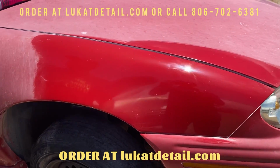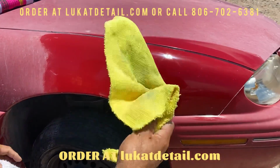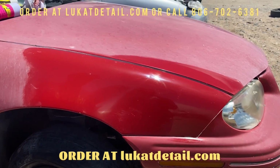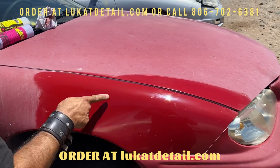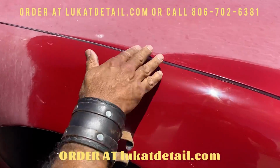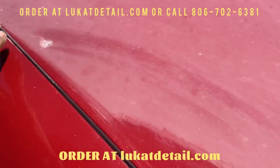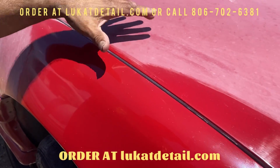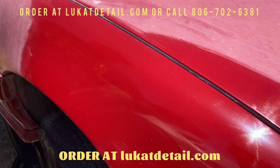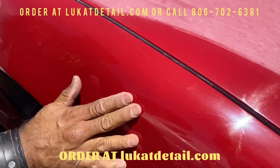Now I like using a terry cloth bath towel for the application, and I use a microfiber towel for the removal. Again, what I did here, I did not wax it. It's clean. Okay, listen to this. This paint right here, do a close-up so they can listen to this. This is dirty, contaminated paint. Listen. Ooh, hot. If your paint job sounds like that, feels rough to the touch, it needs to be clean. When it's clean, listen to this. You don't hear nothing because the paint job is 100% clean.